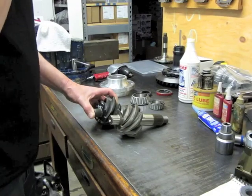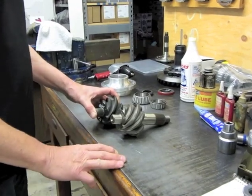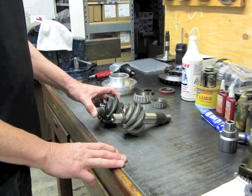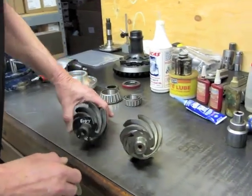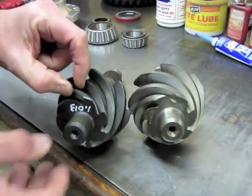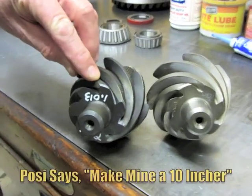What we're doing here is we're actually using a 10-inch gear, which is generated on a 10-inch drawing, but still measures only 9.5-inch wide. The reason we like to do that is if you look at the size of the teeth — this is basically two hundred thousandths width.